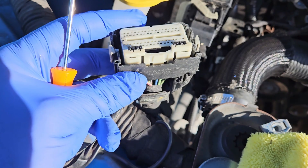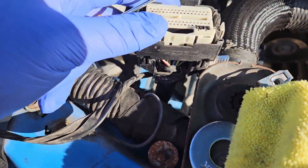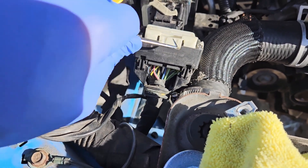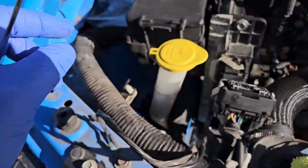You're going to pop the face off of this connector, and you're also going to want to pull this cover off the connector as well. To pop this off, you can use a pick tool, you can use a flathead screwdriver — you're just going to want to go in there and give it a pop. It comes right up and out. Set it aside so you don't lose it.